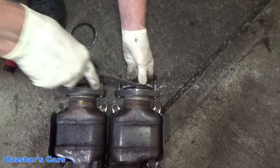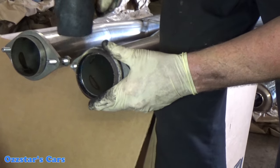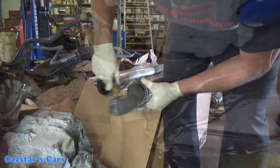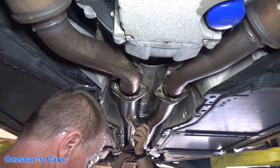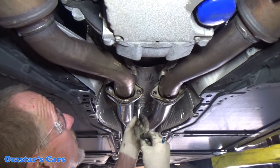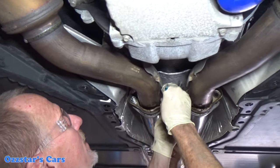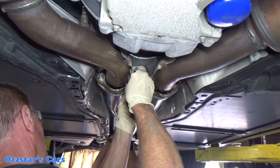The car is fairly new, so the gaskets aren't rusty and crusty. Using a rubber mallet, just tap those donuts on — be gentle, they're a little bit frail and can break. Here Matt's bolting up the flange to the downpipe. There's the new X-pipe going in. There are four bolts and nuts with a couple of washers, and the donuts are squeezed in between — basically it's a gasket, an exhaust gasket. Get those on there and make sure after all this is done that you put the center reinforcement plate back in — it's really important to stiffen the chassis.